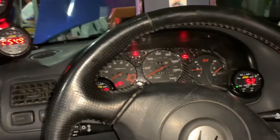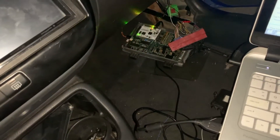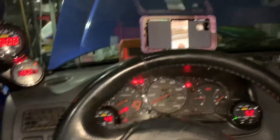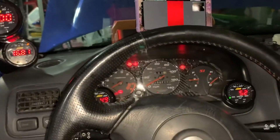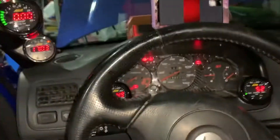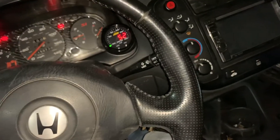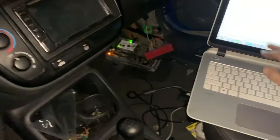It's definitely not gonna start. I have the flashing green light, which apparently is supposed to indicate that my coils are getting power. Yesterday I checked with a multimeter on my coils — there's three wires on the coil. I took a multimeter to it and it has power. I listened to my injectors physically and they were clicking. My thought is maybe I'm still not getting spark for some reason.